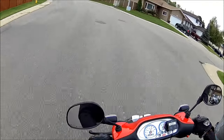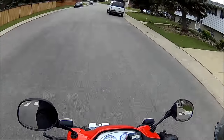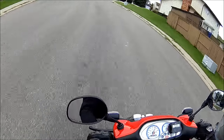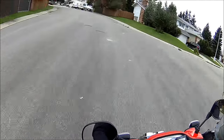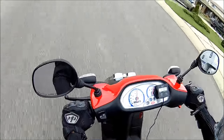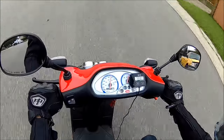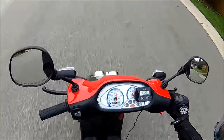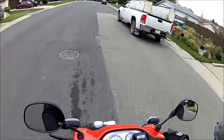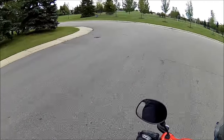I've already cleaned the idle mix and the bike idle is fine. I've also installed a 62 main jet — I think the stock one was 53. Ever since removing the restrictor, engine response is a lot better, but I think it is bogging at the very top end because it is a bit too rich. I am happy with how well the entire install went.